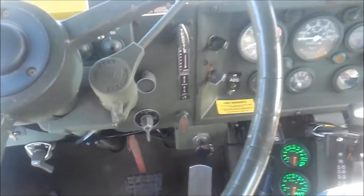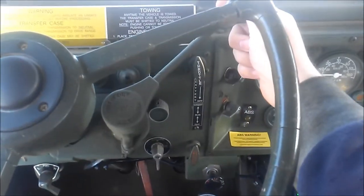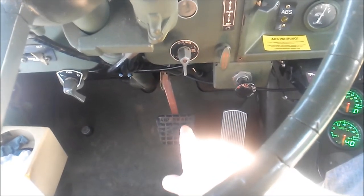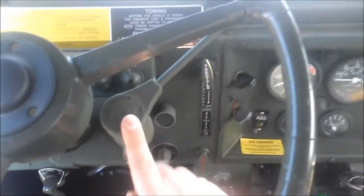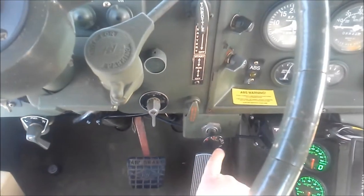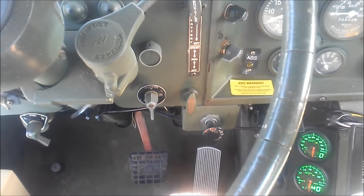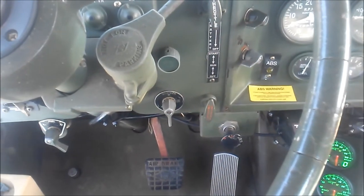That's pretty cool. And another way you could do it is with the trolley brake. But I think when you hit the air brakes, the main pedal, that would actuate it in addition to this. So I don't think that works. That's why I had to plumb it into the charging brake system for the trailers. So it seems to work all right.